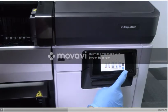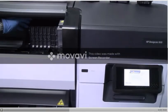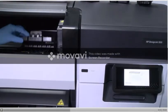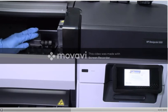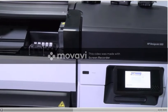The front panel will detect and display the printheads once they are inserted. Close the printhead cover, the carriage latch, and the window. After closing the window, the printer will purge the printheads. This operation takes around 10 minutes.